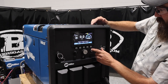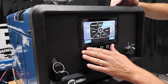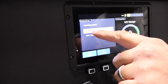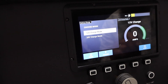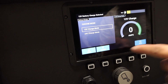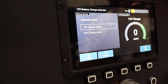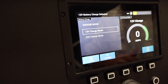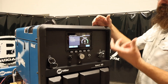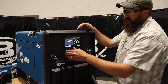It's actually got a battery charge function. We'll go back home here. You can go into battery charge and tell it 12 volt or 24 volt charge. We're just going to say 12 volt selected and then you can charge. When the engine's running, it'll give you the option of do you want to jump start. It's a 150 amp charge and 300 amp jump start. Pretty neat that it has that functionality.